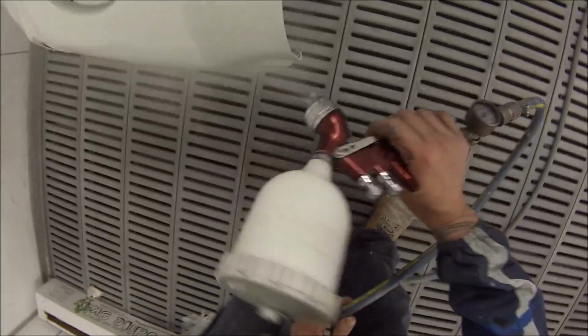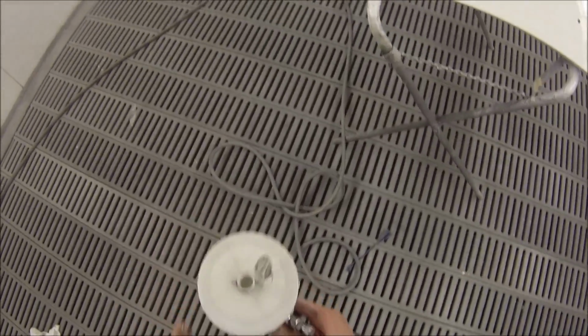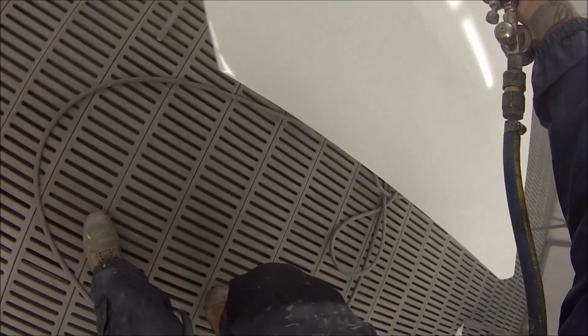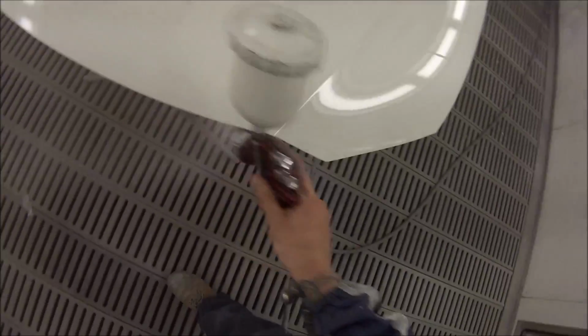So I sprayed my own car in clear over base, but I did it solid because I just decided I wanted the depth of the clear coat, because when you do a clear coat job, you're actually looking through the clear. But for some of the jobs, this is all it needs, is this stuff. I think that the clear coat has a bit more UV resistance to it, whereas with a white, you're not going to need that. It just still does have UV resistance in the 2K, but it's not quite as good. It will go a touch chalky over time, more so than the clear coat.